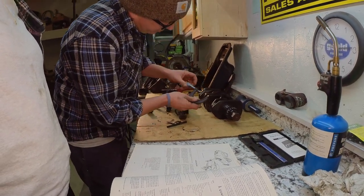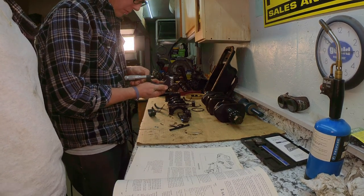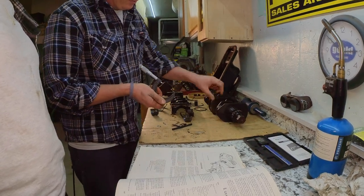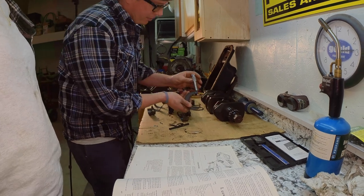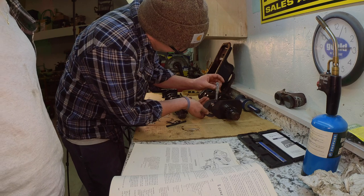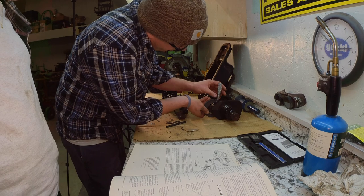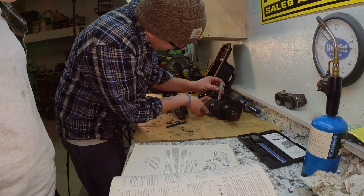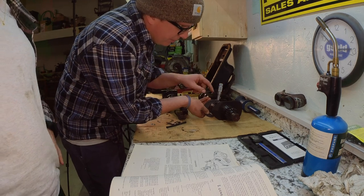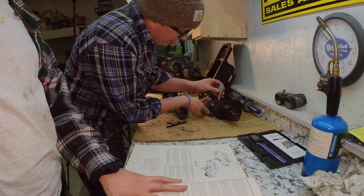What we'll eventually do the next time we do this, Brooke, is measure everything out and record it, and then decide what to do, which way to go. So you always got to wipe your tips off. There's no schmoo on there. I'd much rather use the micrometer than that vernier caliper. The micrometer gets you down to the tenth. The vernier caliper gives you a rough idea as far as I'm concerned. The accuracy of this versus that is inherently better, in the mic.